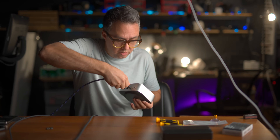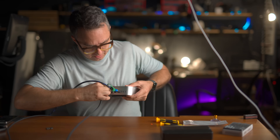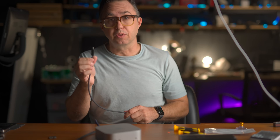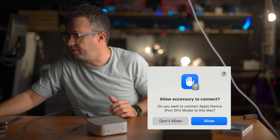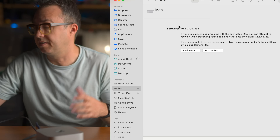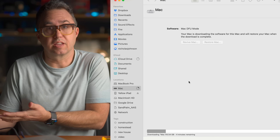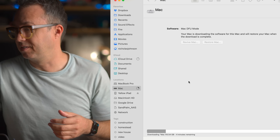This new drive is completely bare, and Apple computers need to hardware pair themselves to the drive. So we have to put Apple firmware onto this SSD before we can install macOS. To boot your Mac Mini into DFU mode, first plug in an HDMI cord connected to a monitor. Then hold the power button before plugging in the power cable, and keep holding it until the light starts to blink orange. Now plug in a Thunderbolt cable from one of this Mac's Thunderbolt ports to a different Mac's Thunderbolt port. It'll ask if you want to allow the accessory to connect — confirm that. This thing pops up with Mac DFU mode, asking if you want to revive or restore the Mac. Click restore. If it doesn't automatically start, you'll have to navigate to the firmware you downloaded from the IPSW website, but mine just had it built in.